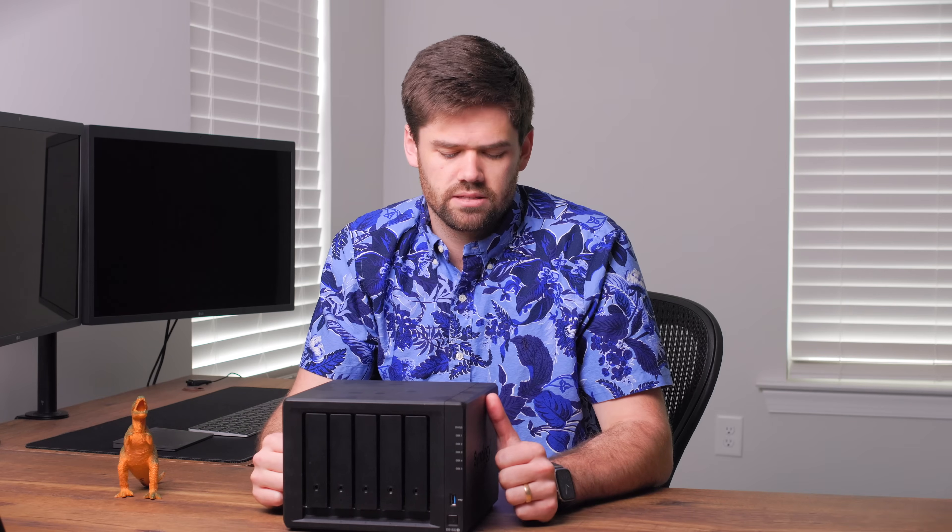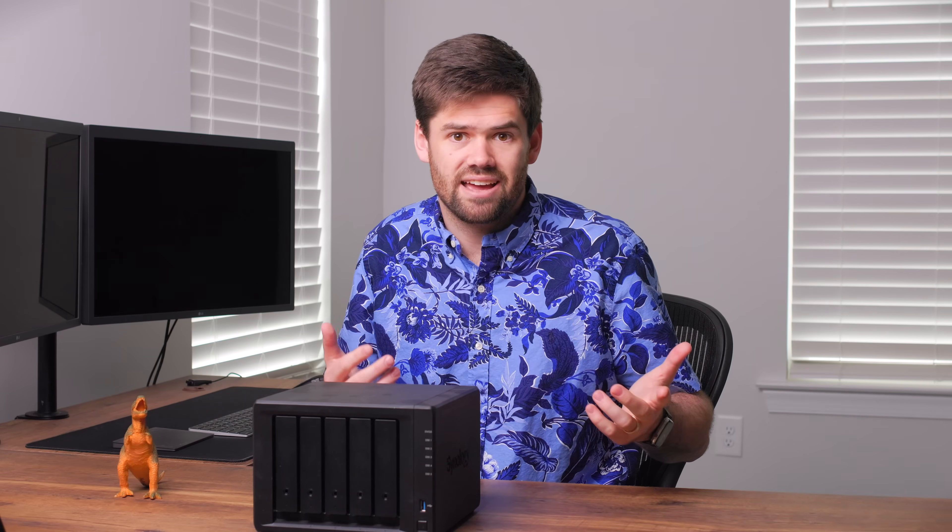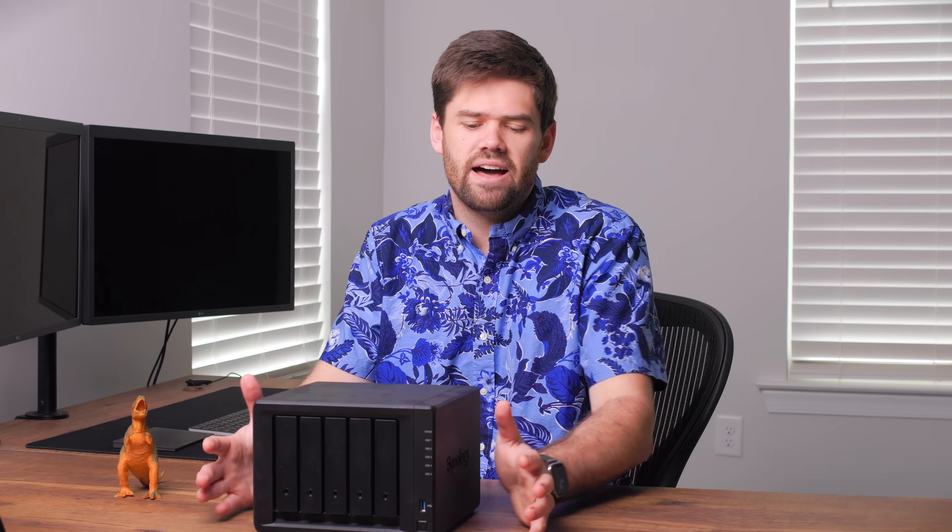The next upgrade is not something every single person can do, but it is definitely where I would start when needing performance. Before you upgrade anything physically in your Synology, run wired Ethernet to the computers that are accessing it most. Your Wi-Fi router says it can do 5.2 gigabit per second — that's just not true. Wi-Fi will get you maybe 30 megabytes per second actual usable. Even a wired one gigabit connection makes a huge difference.